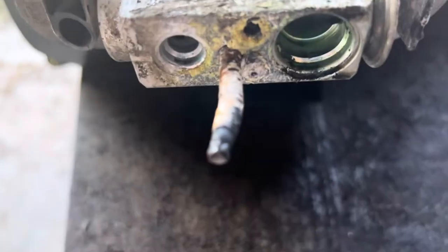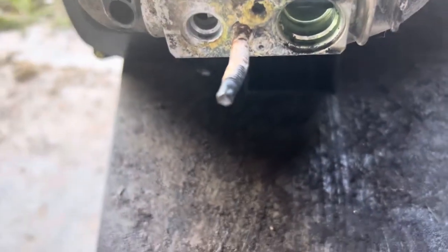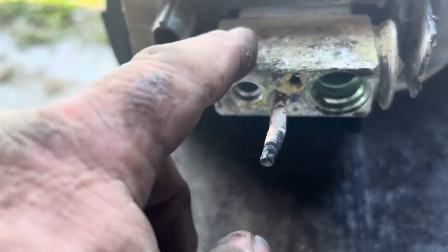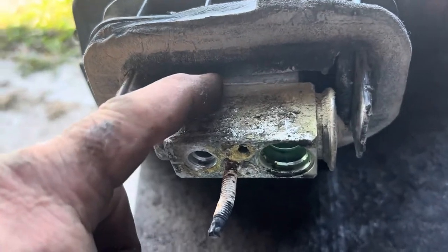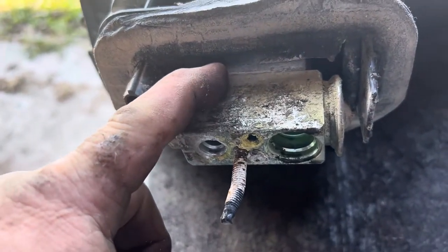And what I've seen on these things, getting this off of the evaporator core is nearly impossible. We're to the point now that they've made available the plate that goes on the top side, which doesn't come with the evaporator core anymore. It's just bare lines. They're not hooked together. They have a hook that hooks into one side and then clips into another. Well, that plate's available now.